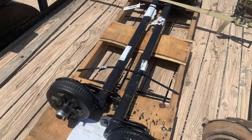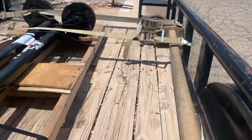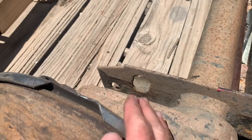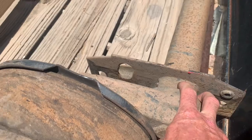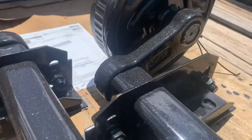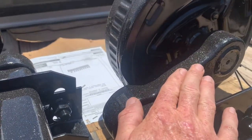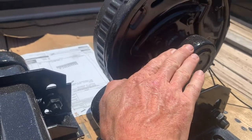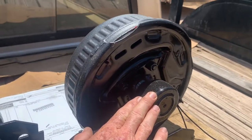Here are the two brand new axles. There's the old axle. If you look at the direction that this torsion arm is, it's parallel with this bracket right here — that means the square bushing inside is worn out. If you look at the brand new axle, there's the same bracket. However, that arm — granted, this is upside down on the pallet — but this arm at that angle, once it's flipped and installed into the trailer, that'll be lifting it up significantly.